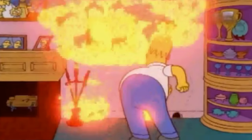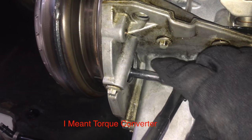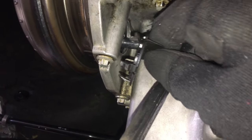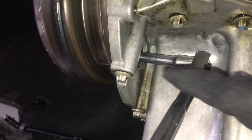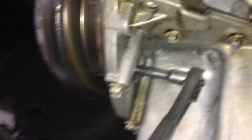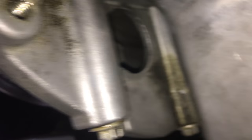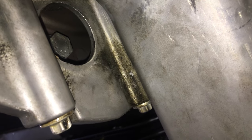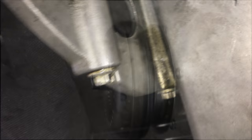I am too smart! S-M-A-R-T! So I'm taking off the flywheel right now, and behind here you should see a black cover — it looks like this. You just pull it back out and it comes right out. Use a 17mm with a little extension, and you can get it out. As you turn it, you can see each of the bolts. You just put it in, turn it, move the flywheel around, and you should be able to get to all the bolts — it just comes around.